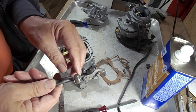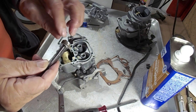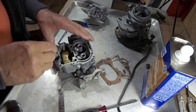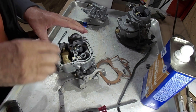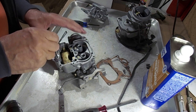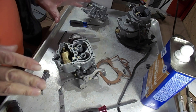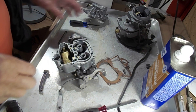This particular one — most WW carburetors — will have a leather cup on it. When you get a new one, just put about two drops of oil on it, no more than that. It may take a while to expand after you get gas in there and may not seal right away, so test it on the bench. It doesn't have to fit super tight in there. That's basically how the accelerator pump works.